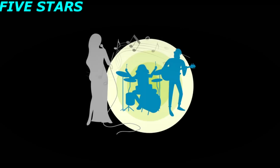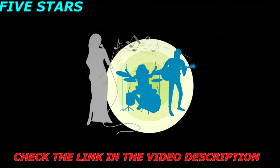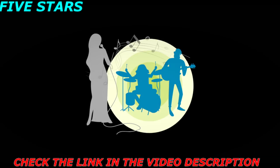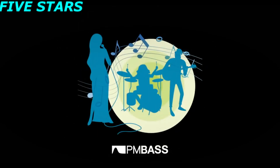So PM bass or phase matching bass, what does it actually do? The best way to think of it is like an intelligent loudness control, and we all know that loudness controls tend to be used at low volumes to help fill out the sound. Now the major drawback with using a loudness control is that you get a phase shift in the low frequencies, and these problems can occur even up to 300 Hz, and this in turn is detrimental to one of the most important areas, which is the vocals, and essentially everything becomes blurry and muddy with a lack of detail. But PM bass has been designed to eliminate all of this muddiness, which allows everything to snap sharply back into focus.